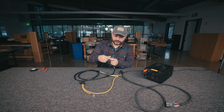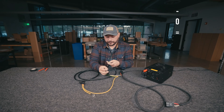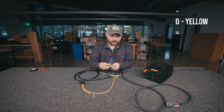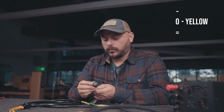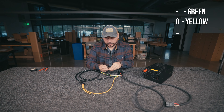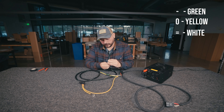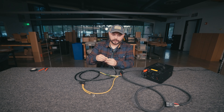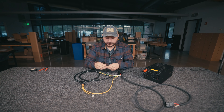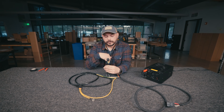Just a quick color guide for this switch: there is a zero in the middle, and then there's one line on one side and two lines on the other side. Right in the middle is where the yellow is going to go. With the single line is where you're going to connect the green wire, and the double line is where you're going to connect the white wire. You just feed them in and push them in until they snap into position. So you've got your zero, your yellow in the middle, your white on the double line, and your green on the single line.